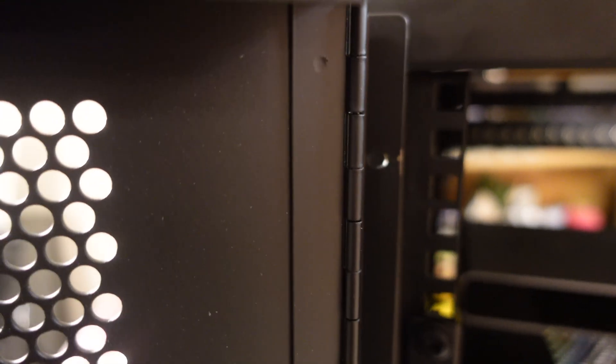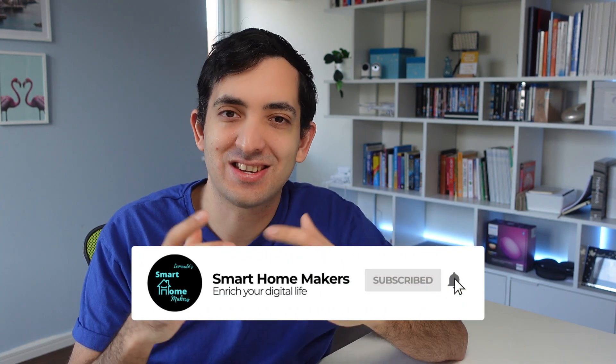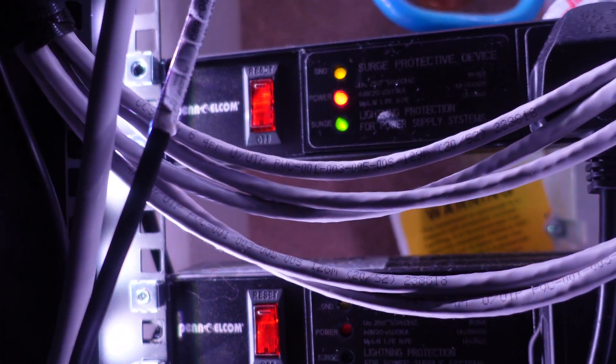If you do have a door, I really recommend putting it in at the end — after you've put all your accessories in and everything is stacked up. Now the next phase is to start planning out your rack, which you can do on paper or using online tools. The cool thing with racks is you can mount things at the front and at the back, giving you a lot of flexibility for things like power units. You want your heaviest devices at the bottom and your lighter devices at the top.